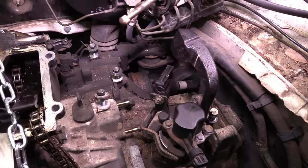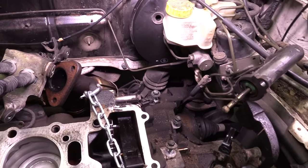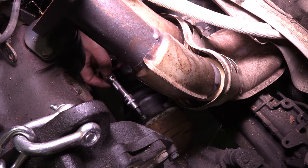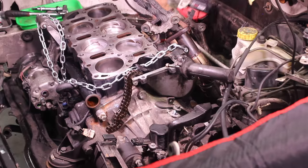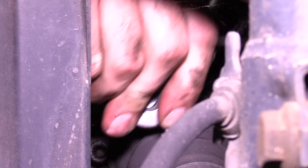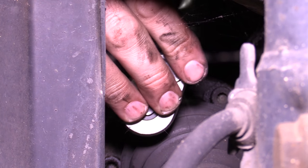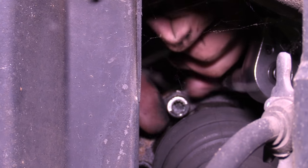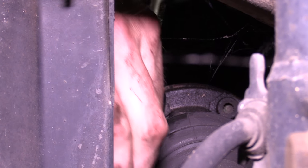Now that we have all the cables and brackets and slave cylinder away from the transmission, next we need to undo our axles. I'm going to need to loosen the six triple square bolts on each side, each inner axle joint, and we're going to leave those in the car. It's really important to get the tool all the way into that fastener because those strip out pretty easy — you don't want to make any more work for yourself. Notice what he did there is he took the bit and wiggled it to make sure it was fully seated. That bolt has a lot of dirt and grime in it, and if any of that prevents the tool from going all the way in, that's a sad day trying to extract a bolt from there.